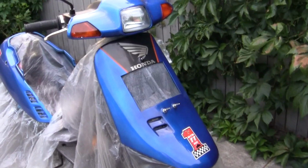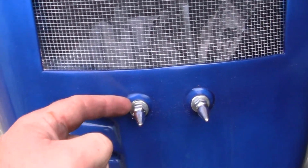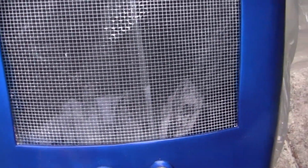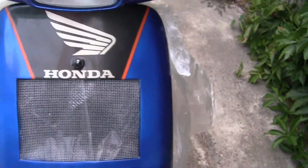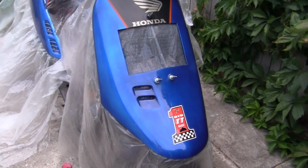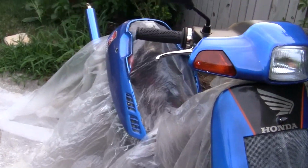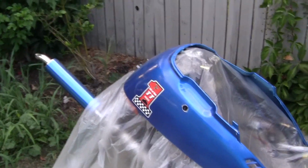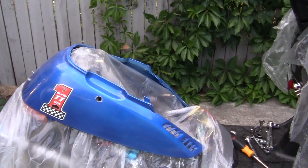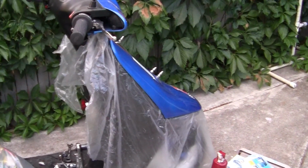As long as you don't burn through your clear or burn through your edges, which are like right here, right here, right here, right down here, up here, then you can just polish away. So we really want to make the front panel and the rear engine cover, and I haven't cleaned it up yet, as nice and polished as I can before I put the final coat of wax on it. So I'm working on the front right now.